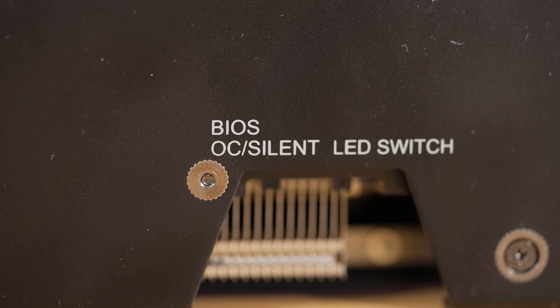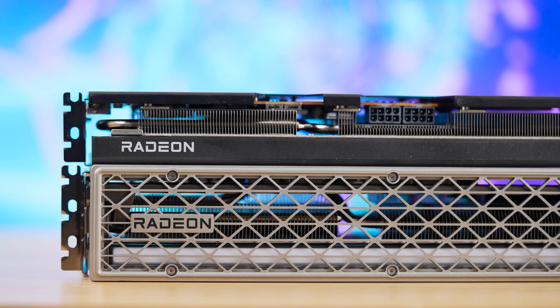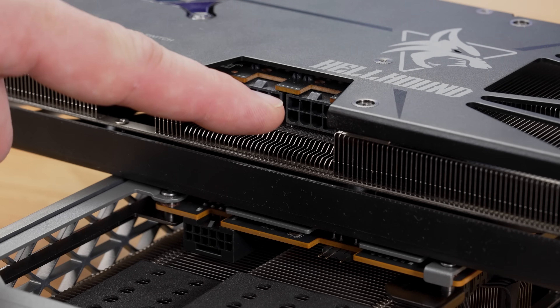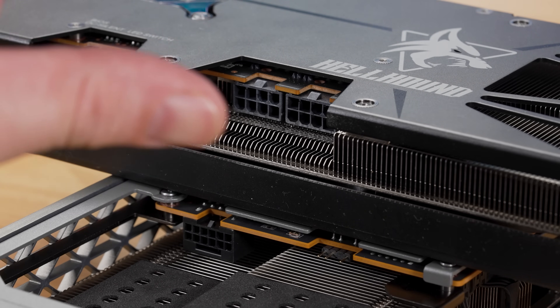Let's talk about the specifics of how to make the RX 9070 go Super Saiyan. First, you have to choose which BIOS you want to put on the card. You can choose nearly any XT BIOS to put on any 9070 card, but there are some restrictions — two things to keep in mind. The power connectors on your card and the XT card you're stealing from definitely matters. If the XT has three 8-pin connectors but your 9070 has only two, that's a fine situation. But if your 9070 uses regular 8-pins and the XT uses the 12-volt high-power connector, or vice versa, that can cause problems and confusion for your GPU. So make sure you don't flash a Nitro Plus BIOS onto a Steel Legend.